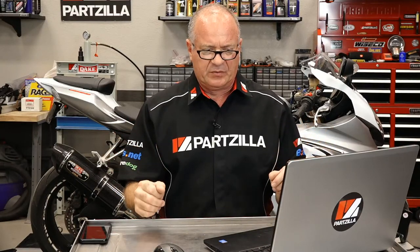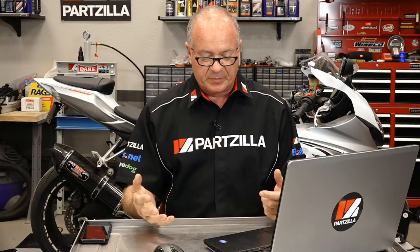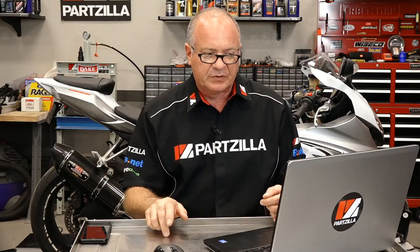All right, Dennis did comment back. He had the 570. He said, yes, and when the power is first applied and has a new belt. Okay, it has a new belt, but did you actually look at the sheaves themselves and did you feel their bearings that they're riding on? Because once again, they're constantly moving for the most part. And if you're telling me you hit the throttle and you can hear it squeal, it's probably going to be coming from that general area. So let's look a little bit closer, take a look at those bearings and the surface of the sheaves themselves.